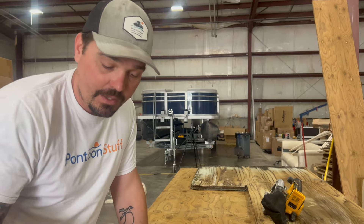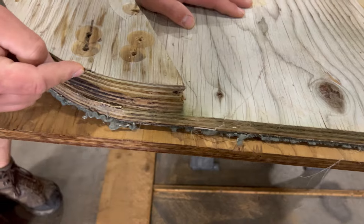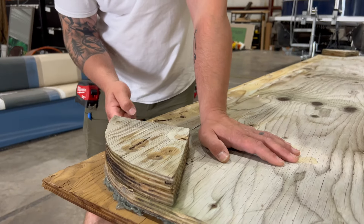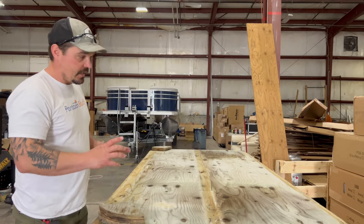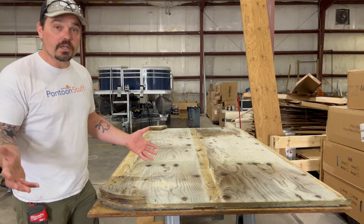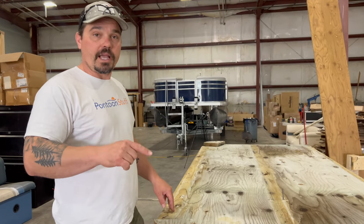I'm going to recreate this at 101 and a half instead of going all the way to 102. I'd trace my front corners and front piece just the same, especially if they have a wider radius for the corner cap — that will make your job a lot easier. Here is the front board off that same boat; I'm going to have to cut a half inch off the side, but this uses a specific curve to match the deck trim. Crest always beefed up their corners to help protect the corner cap. We'll cut this curve with a jigsaw to match the deck trim in front. For the rest of the boards we'll just measure, rip that half inch off, and away we go. If you're using all new deck trim and corner caps, run it all square, make your cut around the motor if needed, and you can make your corner cap cuts with the vinyl on — cut it with a jigsaw, no problem.